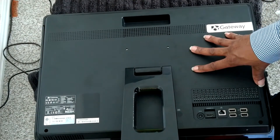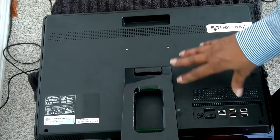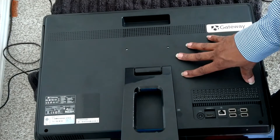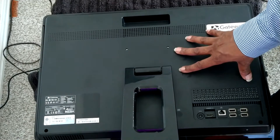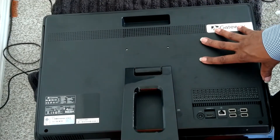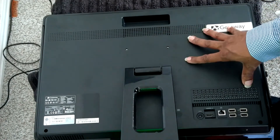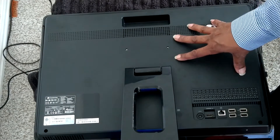What I want to do is upgrade the RAM — it currently has 4GB of RAM — and I'm going to try to get at least 8GB in here. I've also got a solid-state drive that I'm going to install. So I'm going to clone the client hard drive onto the solid-state, install that, and install the new RAM. That's going to make a world of difference for the computer.